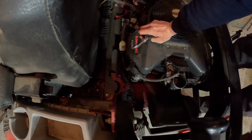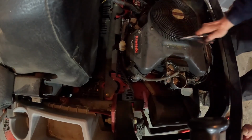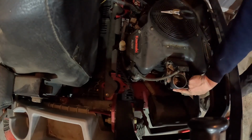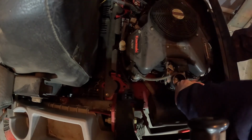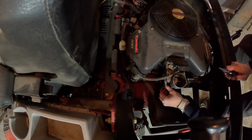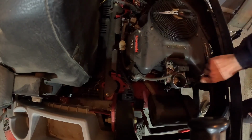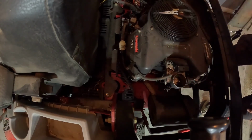No fuel yet. Anyway, I suppose we're going to save the carburetor, so I can go ahead and pull all of that off as well. There's another little air hose, it looks like, right here. Just go ahead and disconnect that. Yeah, I don't know if you can see in there, that piece got removed from there as well. And it looks like those are going to be 10s. There should be 4 of them, but it looks like one broke or something, or went missing.